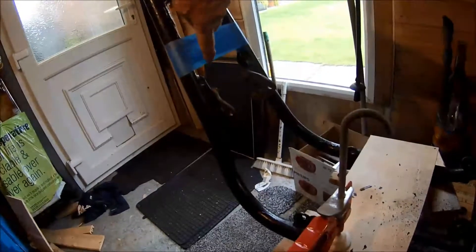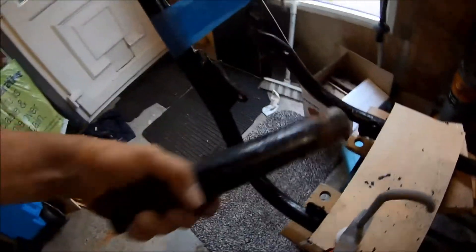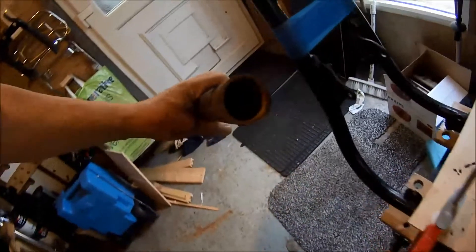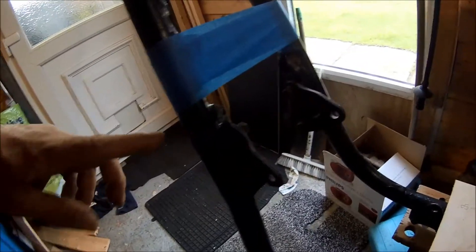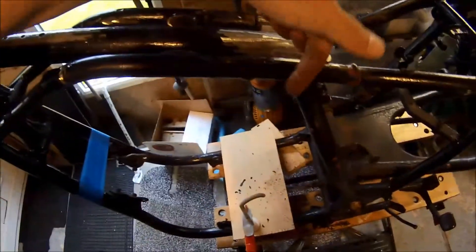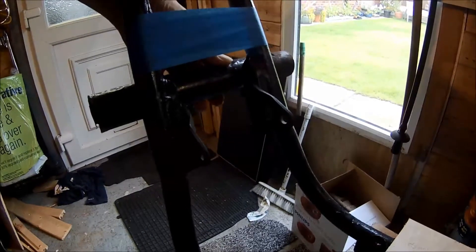The bottom edge of this bit of blue tape is the lowest possible point that the 500 engine's exhaust can come out. So the plan - the devised plan - this is a piece of this pipe that I've used and it's massively strong. Look how thick that is. So the idea is to cut one out and plant it there, so that it sits around all of this and around the tube - all of it - welded all the way around. Once that's in, I'll take an angle at 45 degrees here and then plate it. Same as is going to happen here when I cut this - obviously there's an open tube - I'll put a shaped piece of metal across it and onto this to seal it all up. Do the same thing there - something that thick about there, just enough to clear the bracket.